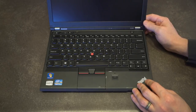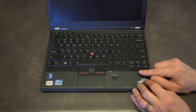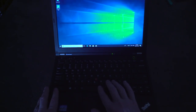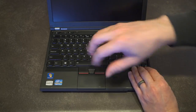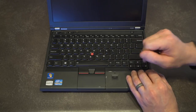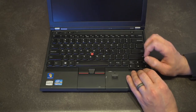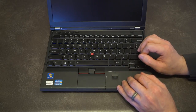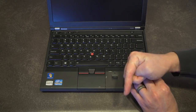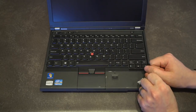The main difference, other than a few hardware updates, is the keyboard. This has now gone to the chiclet style keys, and this particular unit is actually backlit. A lot of people didn't like this move, and there is a mod where you can take the X220 keyboard, isolate a few pins, and install it with essentially no other modification required. However, if you do not modify the pins correctly, it can cause the keyboard to overheat and damage either the computer or the keyboard. I'll leave a link in the description for the steps and conditions you should know.